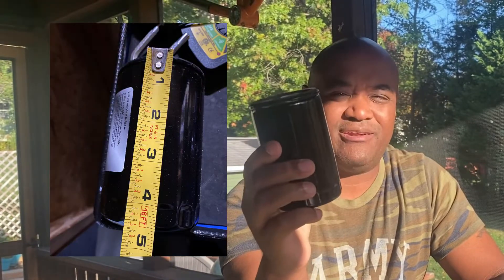After reading up on it, I thought this is the way to go. At approximately $280, the question was whether it would fit my vehicle. The Baxter adapter adds about one inch, and the recommended oil filter adds another five inches — so you're looking at about six inches total. It's safe to plan for a solid seven inches.